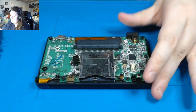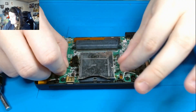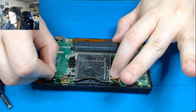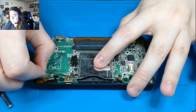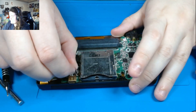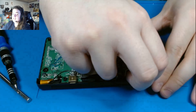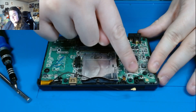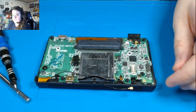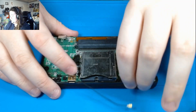So we got our Wi-Fi card — take that off. It's a fun part now, not that bad, but it can be annoying. We have to slide this under, as you can see it goes under this game cartridge here. And there's a lot of stuff under this game cartridge, like the CPU, MOSFETs, and stuff like that. And then we have our ribbon cable here — we want to make sure we pull that off and pull it away.